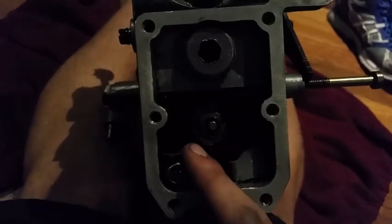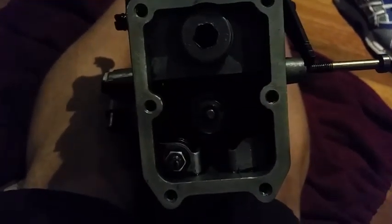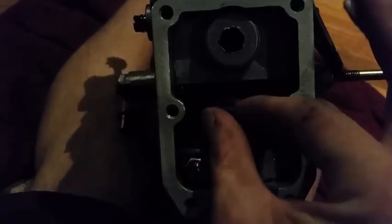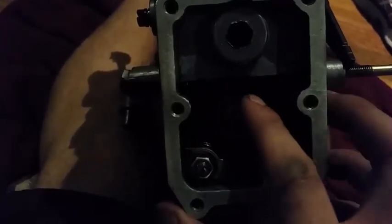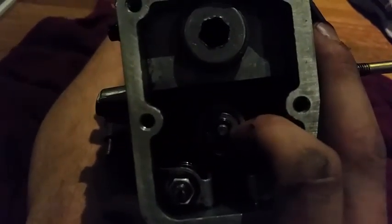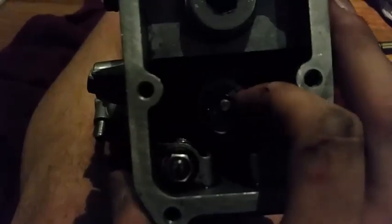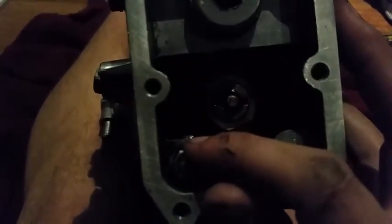Now you have adjusted your full rack travel, which is down here — you'll need to lock it off with a 10mm socket. The next thing to adjust is your torque capsule, which is this one in the middle here. On the outside it's a 19mm, and after that you should be able to wind it in and out with your fingers. The further in you wind it, the more effect the fly weights have versus the governor. Because you've now got further rack travel, these three adjustments all affect each other, so you'll probably have to wind this further in to allow for the extra rack travel you now have.